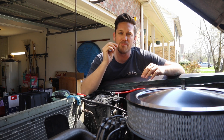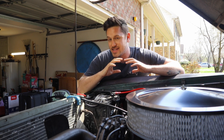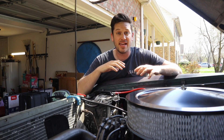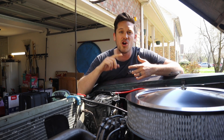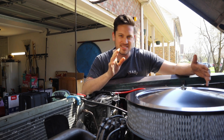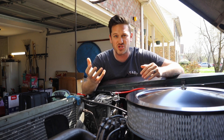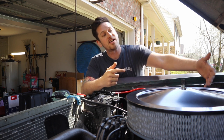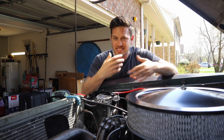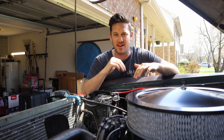The thing that is so important with those wideband O2 sensors is that the exhaust gas is not contaminated — it doesn't have anything else coming in, which includes no outside air. A lot of you guys who are just running headers and a short little tailpipe are probably having some trouble with your EFI system because there's fresh air coming in the tailpipe that is messing with your wideband O2 sensor reading the exhaust gases coming out of the engine.